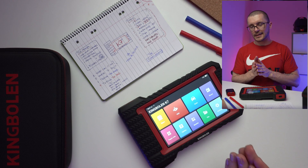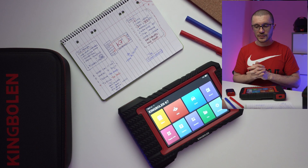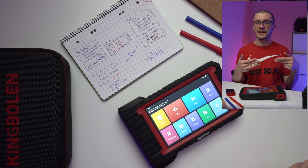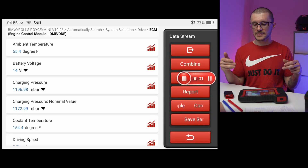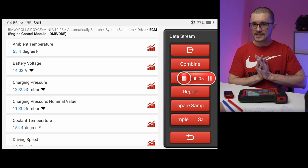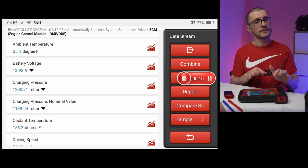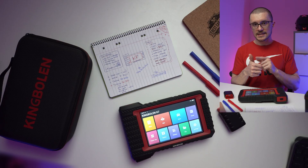I did the data logging on the BMW F10. Data logging is basic by comparison to the X-Tool. I noticed that if I bring up too many data streams — say four at one time — the refresh rate becomes sluggish. If I focus on just one data stream, things are better and the information is more useful. I couldn't find a way to export that information as a CSV, so this unit is not your best bet if you want serious data logging.